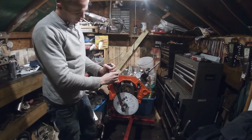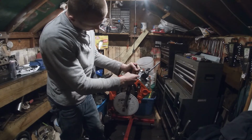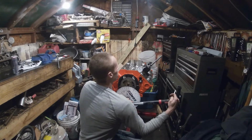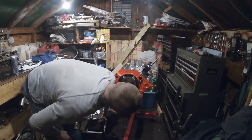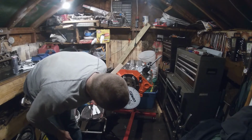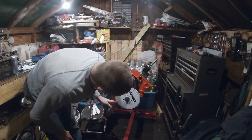Okay, now it's at max lift. We're going to keep going around. We're going to watch. So now it's at 300 thousandths, 200, 100. We're going to keep going around here till we get to 50 thousandths. We're at 50 thousandths. We made our note here that we was 3.5 degrees this way of 0.